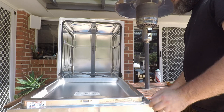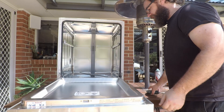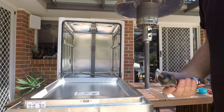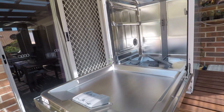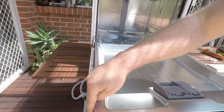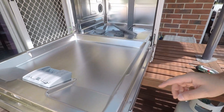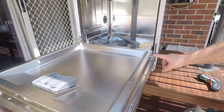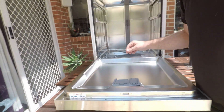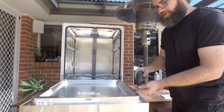Beyond that you'll need to remove the front panel and also the control panel. You will need a Torx T15 bit which you can pick up at your local hardware or electronics hobbyist store. You pretty much need to remove all the screws around the front — I think there's a total of 12 all up — but to begin with just start by removing the three lower ones on each side, that'll give you access to the front panel.